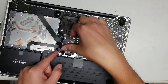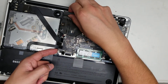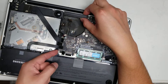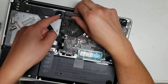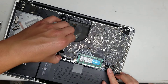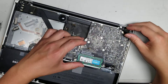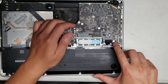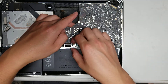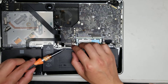With all the screws out, you can actually lift the motherboard up at an angle. This part will usually get caught here, so be careful. It looks like it's stuck — maybe they spilled something or maybe it's just old. There's some adhesive. Don't forget to remove this connector here — I think that's the keyboard backlight connector. Actually, this is the keyboard backlight and this is the microphone. Make sure to remove this as well — maybe that's why it was getting caught; the tape was camouflaging it.